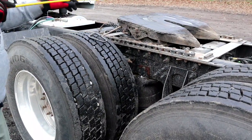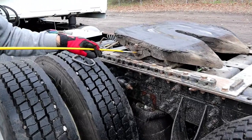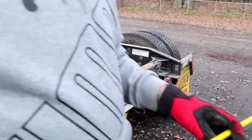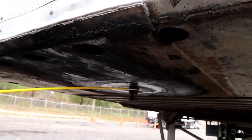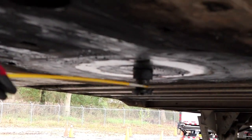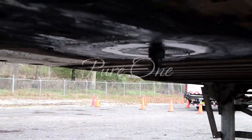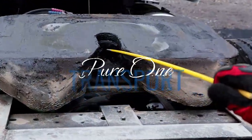In this area we also have the pivot pin, which should be in place, not bent, cracked, or broken, properly mounted, secured, and not missing. Then we get to the kingpin. Looking under the trailer, the kingpin should be properly mounted, secured, not bent, cracked, or broken. We have locking jaws that should be locked around the shank — the shank is the groove of the kingpin where the locking jaw locks around.